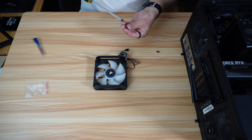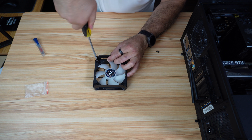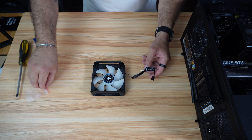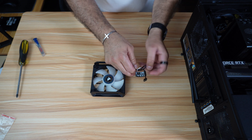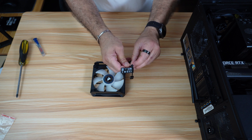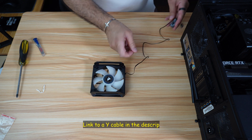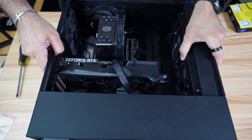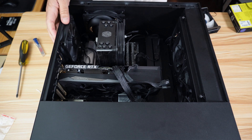This is the second bracket, which should go like this. It is very good of Cooler Master that they provide a second set of brackets. One thing you should also know is that you need to check your motherboard documentation to see if you have an empty fan header. Otherwise, get a Y cable and connect it to the fan header on your motherboard and connect both fans to the Y cable. I'll leave a link in the description for a Y cable in case you need one. On my Asus motherboard I have another header available.